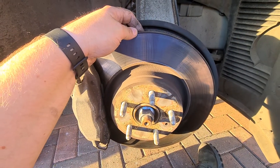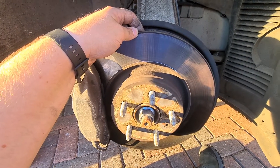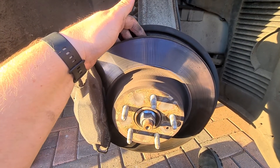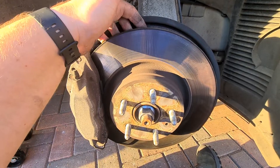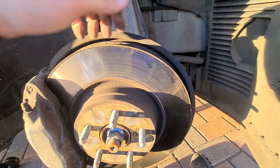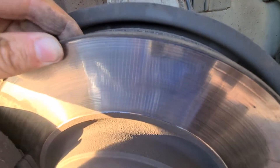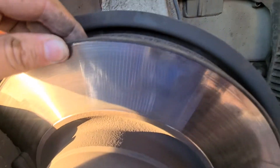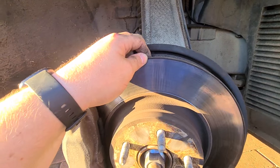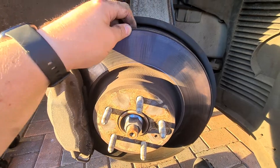What I have found that's different — I've obviously had both sides of the car lifted to look at the anti-roll bar and any rattles on that, and the linkage to see how any play, but couldn't see anything. One thing that is different front left to right is the amount of slop in the mechanical drive linkage. If I turn the wheel a bit and try to hold it so you can hear, there's quite a lot of slop and rattle in that, which isn't present on the other side. So I'm not sure if that's the issue.